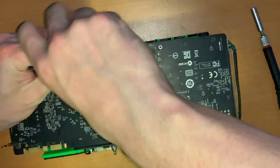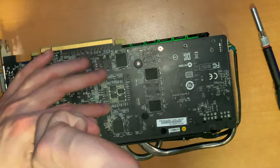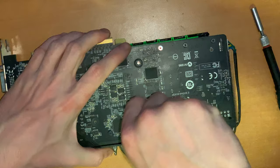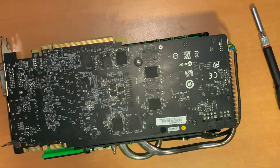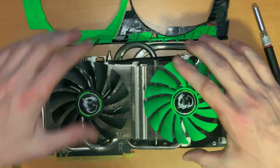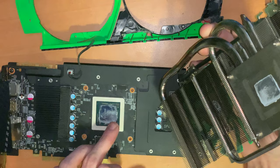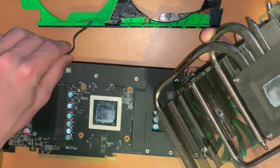I do have to remove these screws to lift up the heat spreader. These are spring-loaded so you have to take care of those. The thermal interface will become loose after this, so you need to put on new thermal paste. I have some MX4 left but not a lot. I might reuse the thermal paste for now but won't use the card until I get new paste. That thermal paste looks like it has spread — that's crazy and odd, but the thermals were really good so it doesn't really matter.